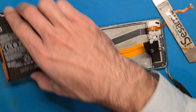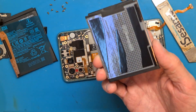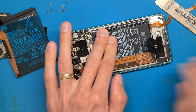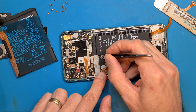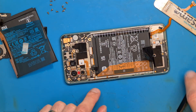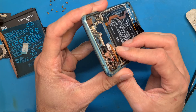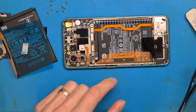Let's get the new original battery. Remove the plastic protection cover from the double-sided tape and try to align the battery with the frame. Push down on it so everything gets nicely glued together. We need to remove this paper here. Connect the SIM tray flex cable and try to align the battery connector, then press. Looks like everything is okay.